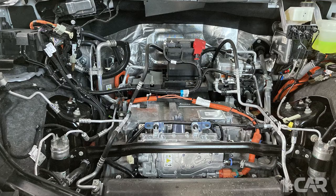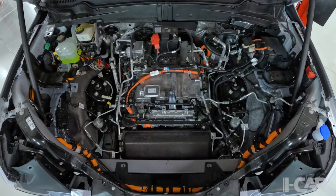And we can stay paused on this for just a moment. You'll notice there's two receiver dryers. Again, I'd mentioned there's two separate AC systems. They want to take care of that high voltage battery, and then they want to take care of the people in the vehicle. And they very strategically do that. That's something unique with the F-150 Lightning that I haven't seen in any other battery electric vehicles at this point yet, where they have two separate AC systems, one for the battery and motor and stuff, and then one for the actual cabin.